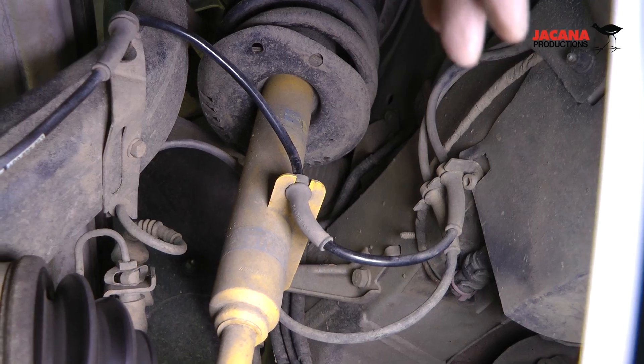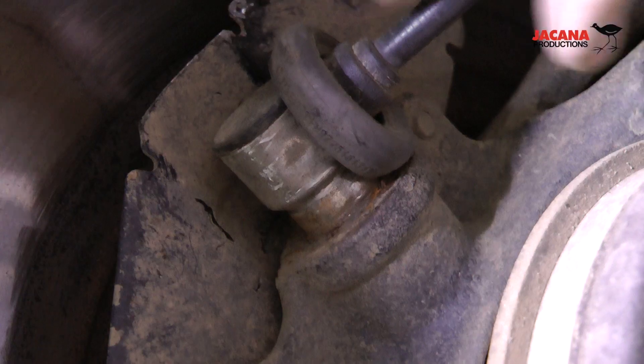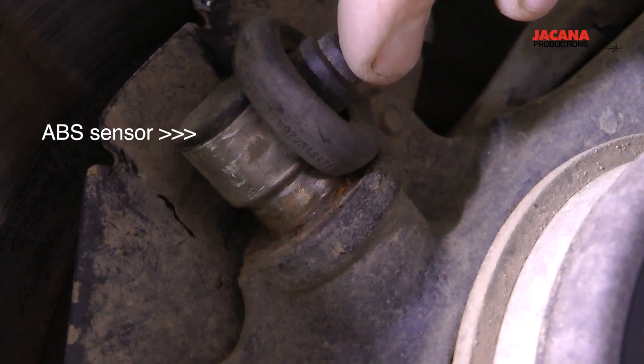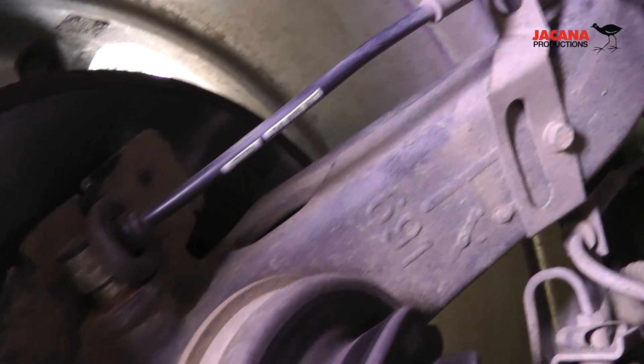I showed you the symptoms of what's happening. Turning the wheel — in my case, turning it to the right, which makes my front wheels turn — is causing me to have this fault. So it's either going to be the computer (which is only $99 to fix), the cables between the ABS computer and the sensors, or the sensor itself. I started out by trying to take the sensors out. The guy on AudiFans has instructions on how to take them out — they're meant to pop out, but mine are rusted in, so forget about it. Hope to God it's not a sensor.